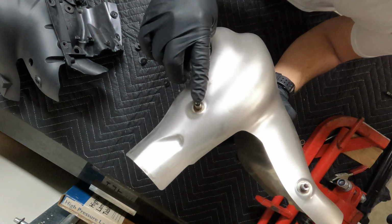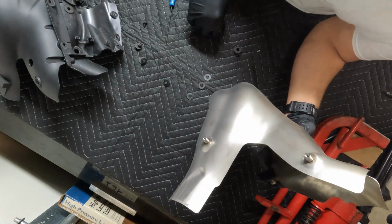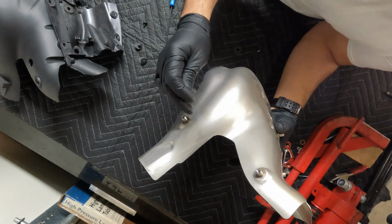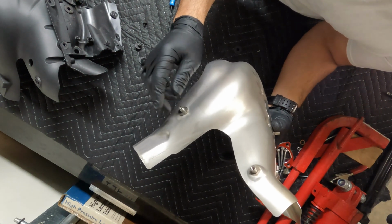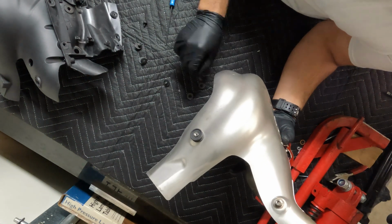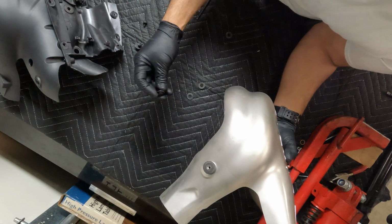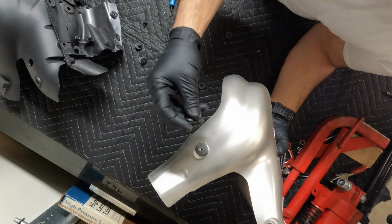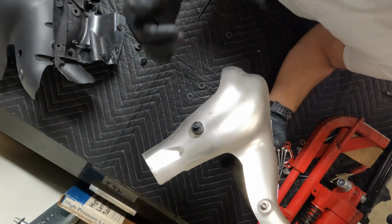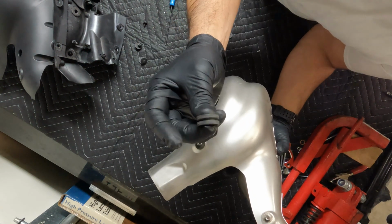So these dowels on the underside slide through the bushing that's in the plastic surround. Just in case things pop out and fall all over the place, know that on the underside, you have a fiber washer. Then this dowel slides through the rubber grommet. On top of your grommet, you're gonna have another fiber washer, then the metal washer and then the screw. That'll go through your actual plastic shield, or in my case, the carbon fiber one. So I'll insert these rubber grommets into the carbon fiber.